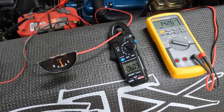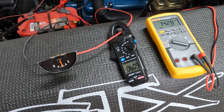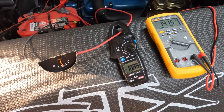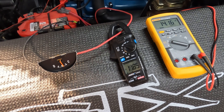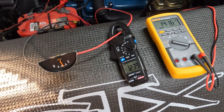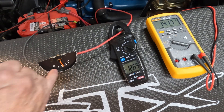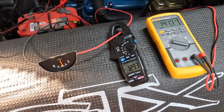Let's hook up the load to the battery now and see if we have a change in the ammeter. It does have a 100-watt H1 bulb in it. We've got 12 to 13 amps floating now across the ammeter — we have an ammeter charging indication that wasn't there before.